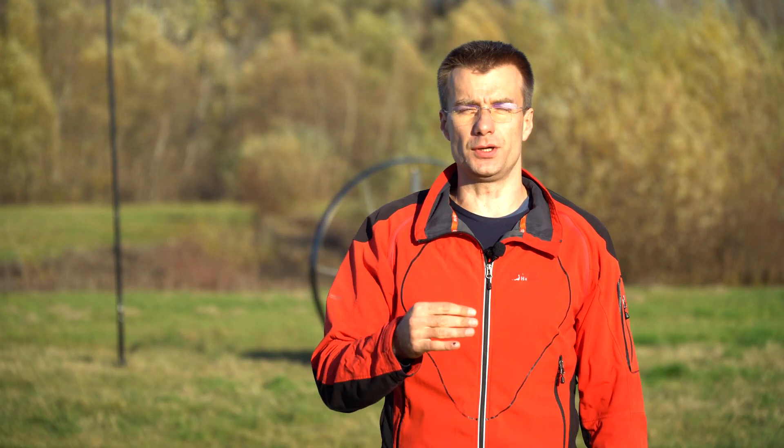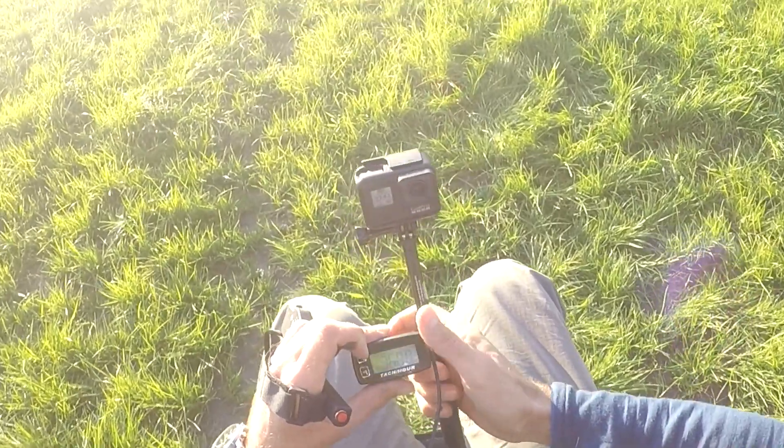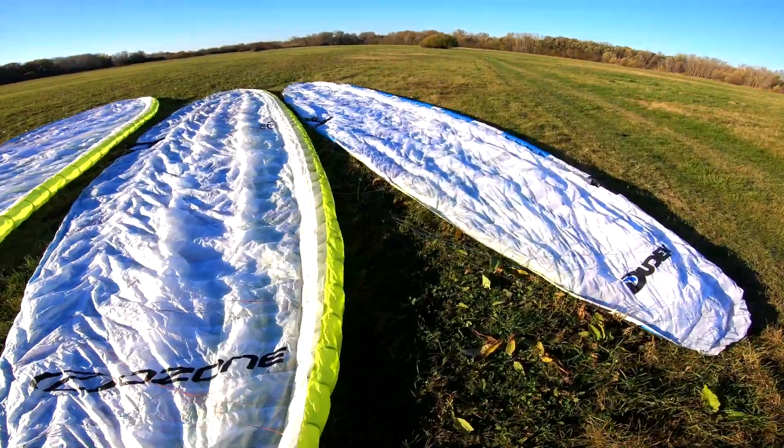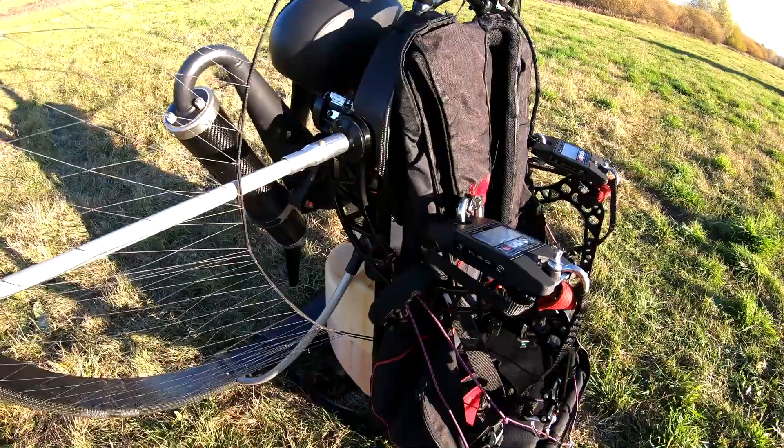There are four parameters I'm going to measure with each glider in the air: first, RPM; second, airspeed; third, the torque reading on both scales; and fourth, how many seconds it takes for the glider to turn 90 degrees induced only by torque. I'll fly hands-off, not interfering with the steering, letting the torque steer it to the right. The more torque I'm facing, the faster it will turn — but a more agile glider will also react more dramatically, so you can predict what to expect when upgrading.